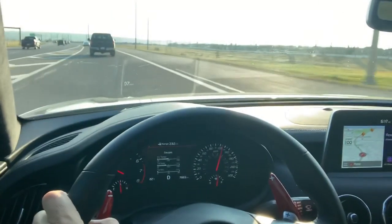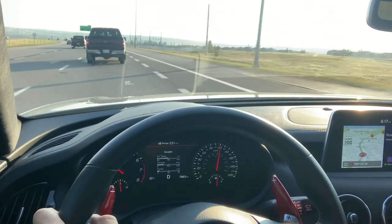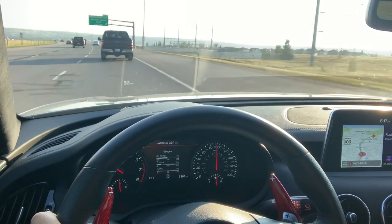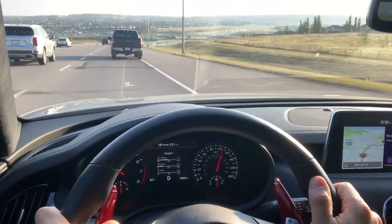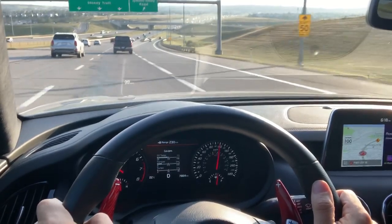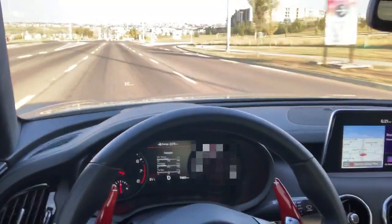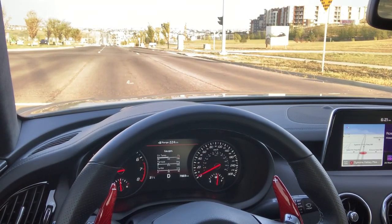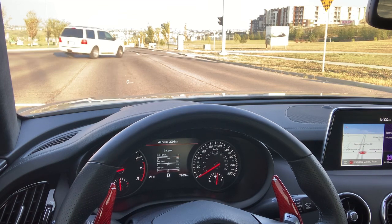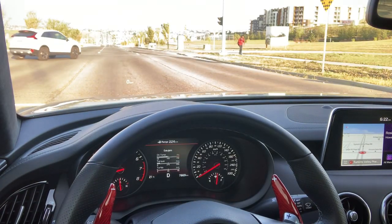The bedding process is done — jumping on the highway now. I'm going to get these brakes hot and see if the shake is stopped. I'll keep pressing the pedal, kind of riding the brakes to heat them up. Don't feel anything yet, but I haven't had a good hard application going downhill. Applying them — not feeling a vibration. My old brake pads would definitely be vibrating. There is a slight little vibration, it's very slight though. The steering wheel used to shake quite a bit — now I really have to pay attention to notice anything. My brakes are really hot right now, so I don't know if there's a temperature threshold.